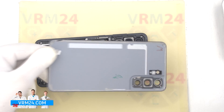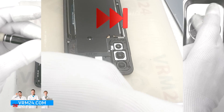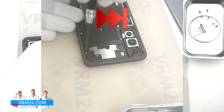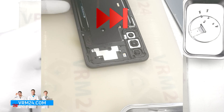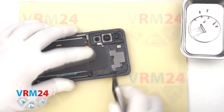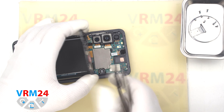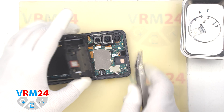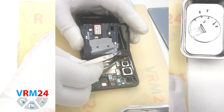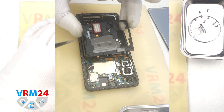On the cover we have the flashlight elements and the gasket. After that we need to remove the screws at the top. For this we use a 1.5 mm Phillips screwdriver or #3-0. This will allow us to get to the battery connector that we need to disconnect. We need to carefully lift the cover and use a non-metal tool to disconnect the wireless charging connector.